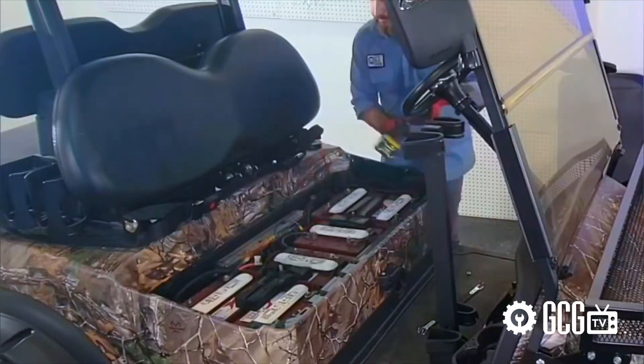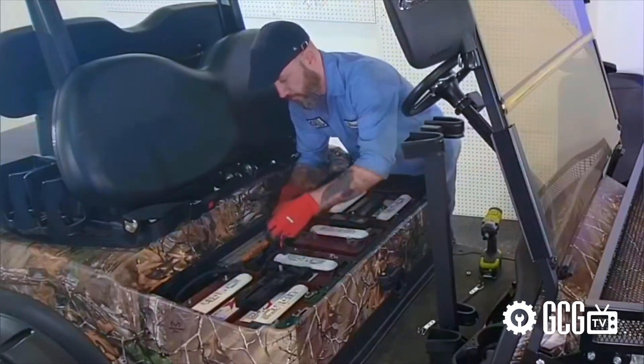Next up, we like to remove the main cables to the vehicle harness and charge receptacle, and wrap the ends in electrical tape until we're ready to reconnect them.